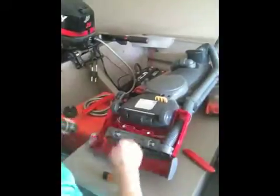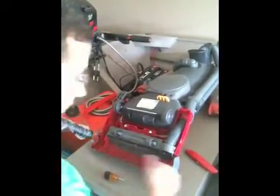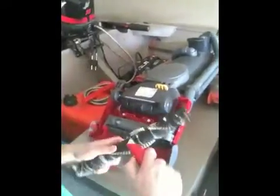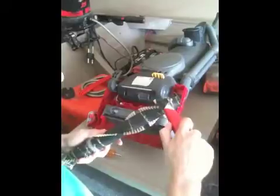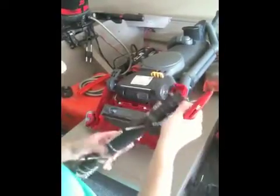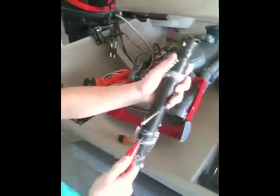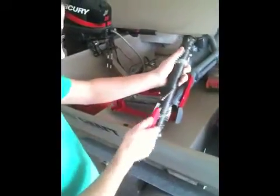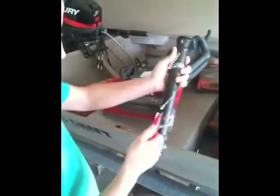This is also a good opportunity to clear away any debris inside your vacuum cleaner, and to cut the strings off your brush roll with the razor blade. This is the number one way to burn through a belt right here, is to get too much debris and strings wrapped around your brush roll. This was cleaned off probably 4 or 5 days ago, and it's that bad again already.